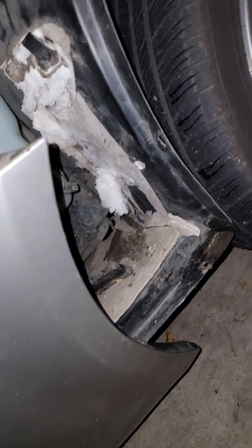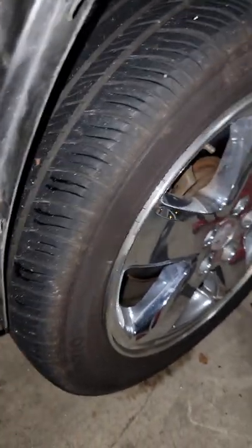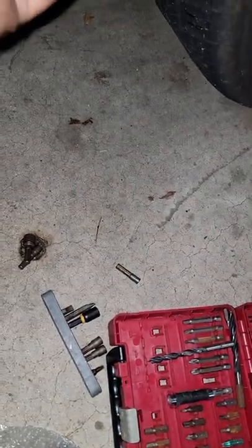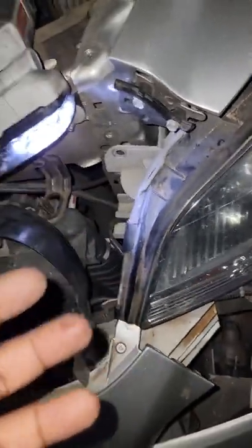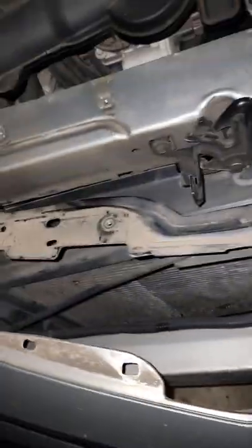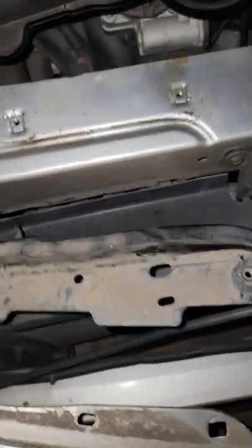You've got to take this 10 millimeter screw out right here, pull out these rubber plugs, and there are some small screws that hold this in place — you have to take those out too. Then you have to unhook the bumper. In order to get in there and change the light, I figured out how to do it without taking the whole bumper off by just taking that side apart, but I decided to take the whole bumper off.